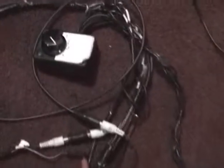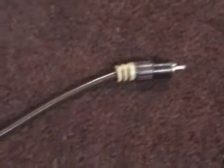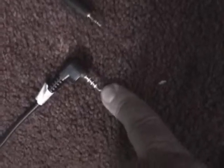But that control box is mounted right up front, easy to get to, and it runs all 4 cameras through it. So you do have a mess of wires. It is kind of a mess, but you can see the bulk of it running down, video and the sound all running together. Coming back, the red and white there would be the sound, and that yellow one is the video. They all come together right there, come around, tie into this connector, and then this single 4-pin connector is all the connection you need for the audio and the video into the camcorder.